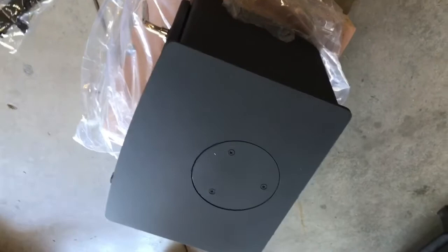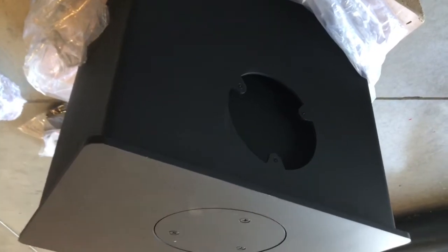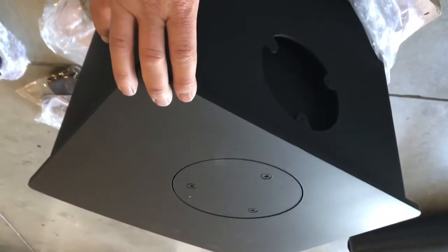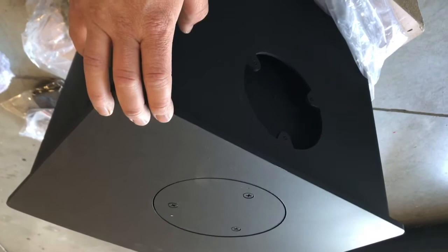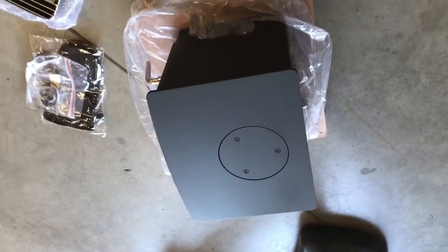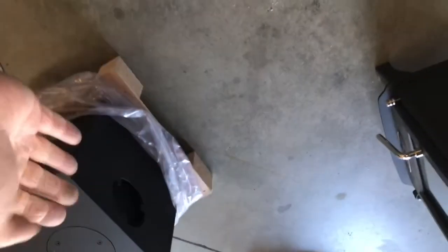Just like your stove, the oven has a top and a rear exit. The flue flange from your stove will mount to whichever side you want to vent on. If you're in a narrow application you'd vent out the top, but if you want to use the whole top surface for cooking you'll want to vent out the back. So let's go ahead and remove that flue flange, flip this over, and show you the fitting and how it goes together.